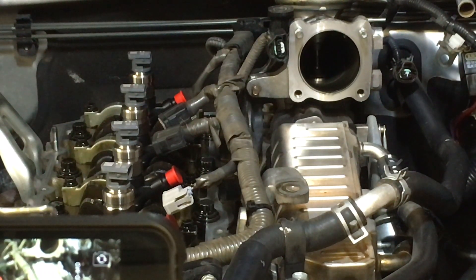Then you need to go into the utility of the scan tool. Pilot Learn Detail is what we use — it might take a little bit longer, but that's how we do things. Detail — not the quick, short one. It's the proper, long, detailed version. So I hope that answers that question. What have we got covered here? EGR plate — look how clean it is, it works.